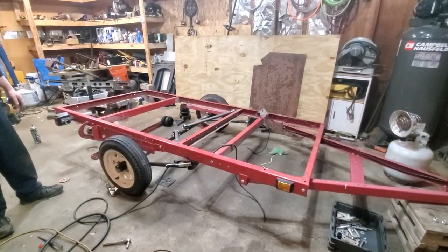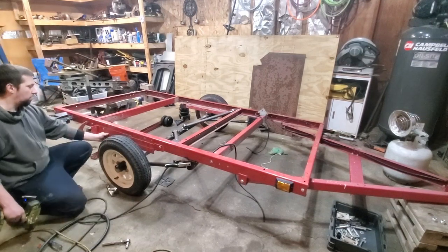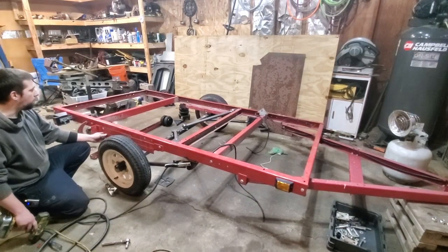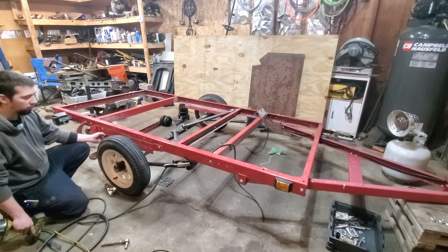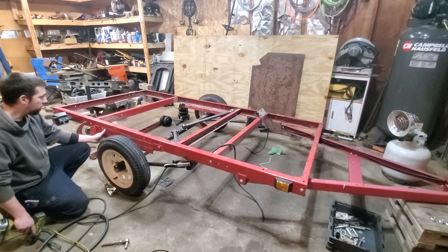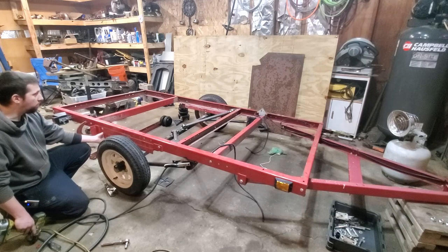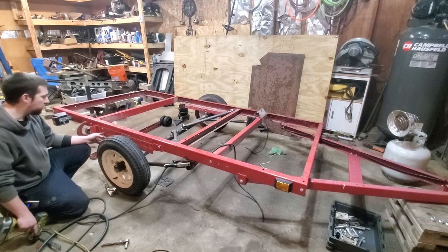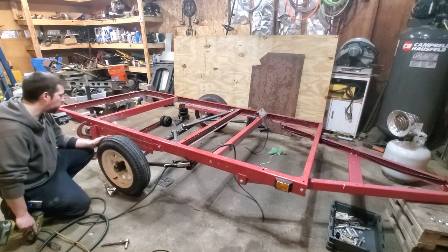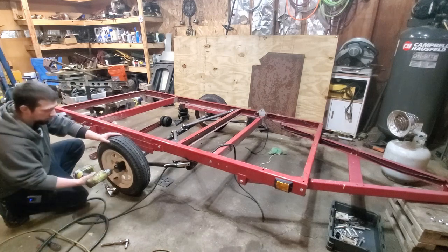What I'm doing now is removing the wheels one at a time. There's a piece of angle iron under here that was for the leaf springs — it held the leaf springs in place. Now that I've proven this works, I don't need it anymore. I'm going to remove that and it'll allow the frame to actually drop down lower. I'll just take a grinder — there are four small welds on the front and I believe four on the back — and cut the welds on that.